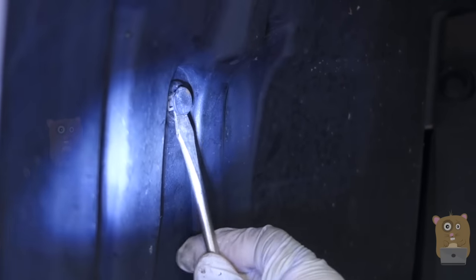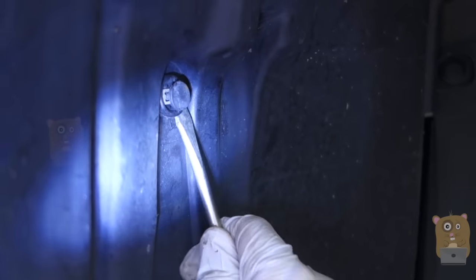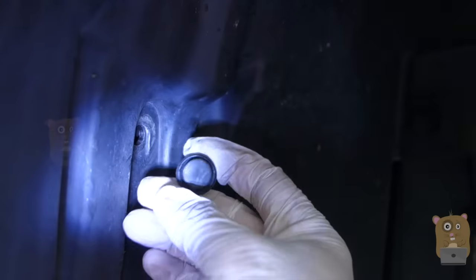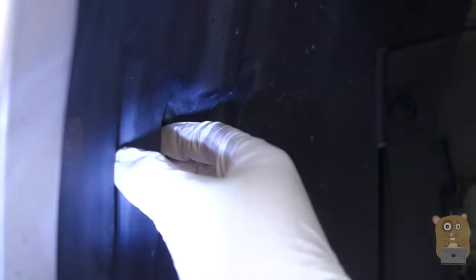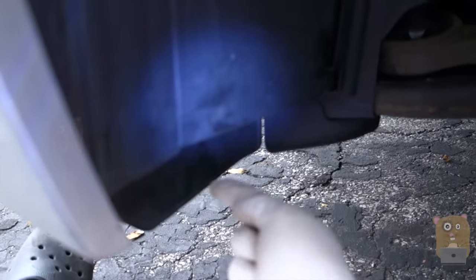Just pry it a little bit to loosen it, and now I can pop this part out and pull the rest of the way. With this little piece pushed in, it locks in place. There are about seven or eight clips throughout this little plastic fender piece — up here and over there. You just need to remove enough so you can pull the plastic liner back to access the bulb. There are also about three of them on the bottom.